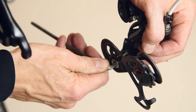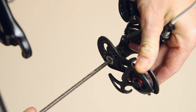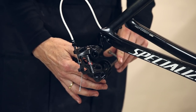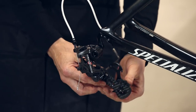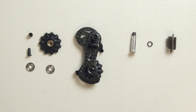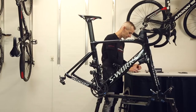Loosen the lower pulley as well to get free access to the pivot bolt on the back side. Next step is to take the allen key 5 and loosen up the pivot bolt. Hold with one hand the cage because there is still spring tension on the cage. Loosen the bolt and let the spring tension release. Next step is to remove the cage including the spring. We need to reuse the spring, the metal washer, and the pivot bolt. The rest we do not reuse in this installation.